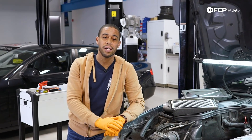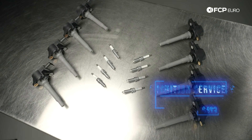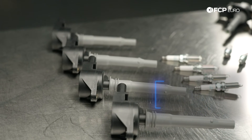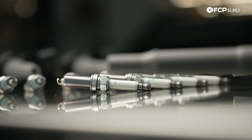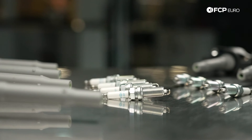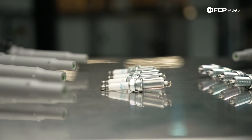The last thing to look into in terms of periodic maintenance is ignition service. Coils are pretty resilient on this motor, but you want to be doing the spark plugs every 70,000 miles. Sometimes if you're dealing with platinum or iridium plugs, the recommended interval is like 100,000 miles — I definitely recommend sooner than that. Every 70,000 miles, throw a set of plugs at the car.